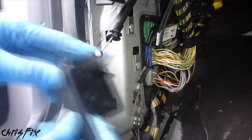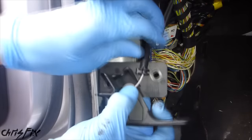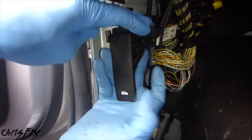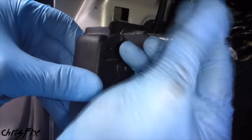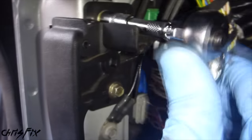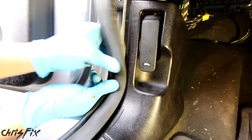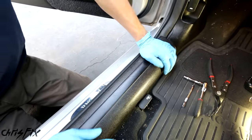With the new cable pulled all the way through, let's reconnect the hood release latch in the interior. Grab your hood latch, pop the cable ball right into that socket just like that. Then press the latch in just like before we took it out. Now bolt it up into place — screws go here and here — hand tighten first, then snug them up. Now get the plastic trim pieces and snap them right in, then move the weather stripping back into place. We are done with the interior.